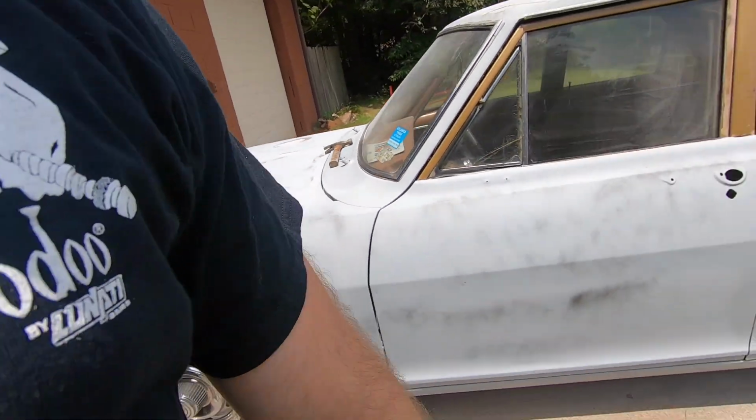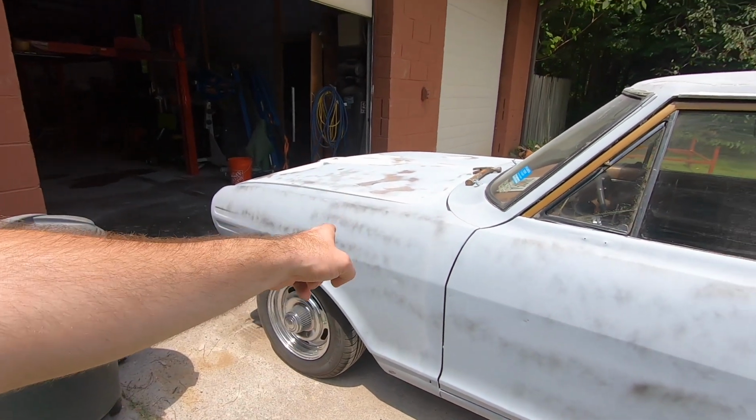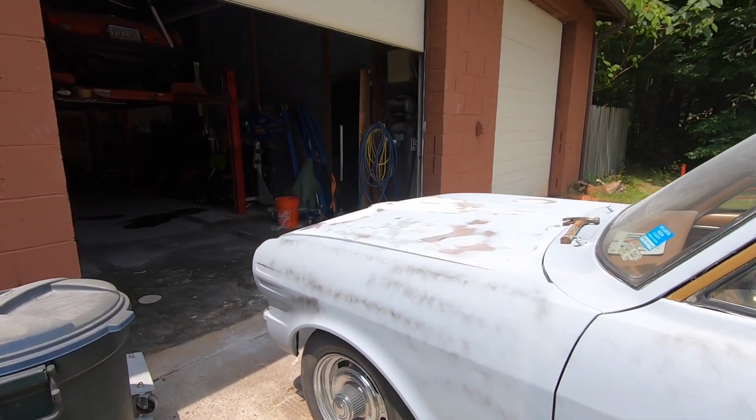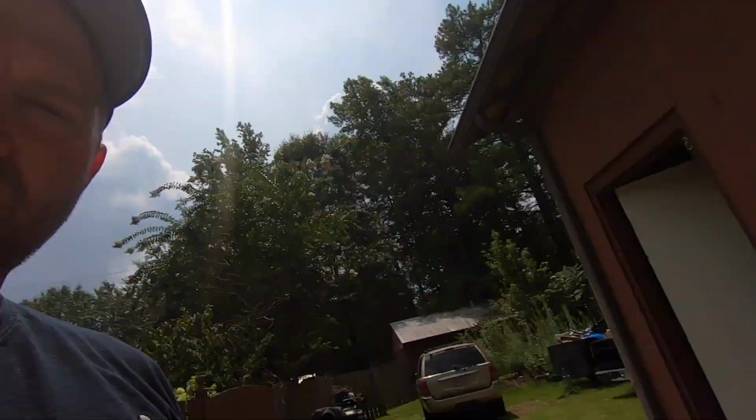We're gonna prime it again. This time when we prime it, we're not at square one anymore. We've kind of got to that next level. So we'll prime it and we'll block it down at least one more time, see where we're at, make sure all of those imperfections are gone before we do our final priming, and that'll put us really ready to wet sand and paint. But we still got this other side to do, and I wanted to save that for you guys so we could work one panel together. So we're gonna do that. And I think I'm gonna choose the front fender. So let's get to work.